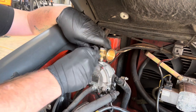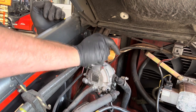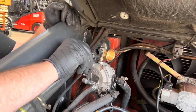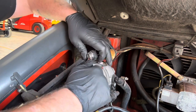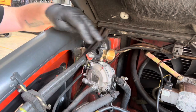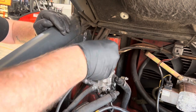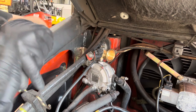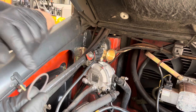Get your solenoid and put it back on. Get your 10 mil — again, it doesn't have to be massively over-tightened, just snug enough so it doesn't come undone. Make sure you plug it back in, otherwise it won't work. Then with your gas filter, the rubber seal goes in first, down in the very back. If it doesn't stick when you're trying to put it in, just put a tiny bit of spit on it and that will help it stick.